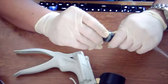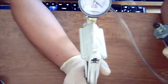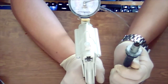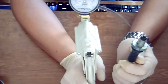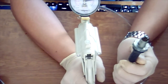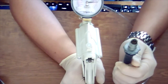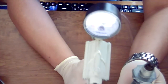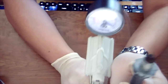So we'll place this rubber interface in here and get a nice tight seal — completely sealed around there. Looking at our vacuum gauge, we're going to want to see that when we apply vacuum to it, it doesn't move. This power valve actually is pretty good — almost perfect — but it does have a very slow leak, slowly bleeding down there. That may just be due to my rig, but I was noticing a faster leak when I was messing with this before. So I do think this power valve is still problematic, which is why I replaced it. If we bleed off some pressure, we can see when the power valve begins to move.